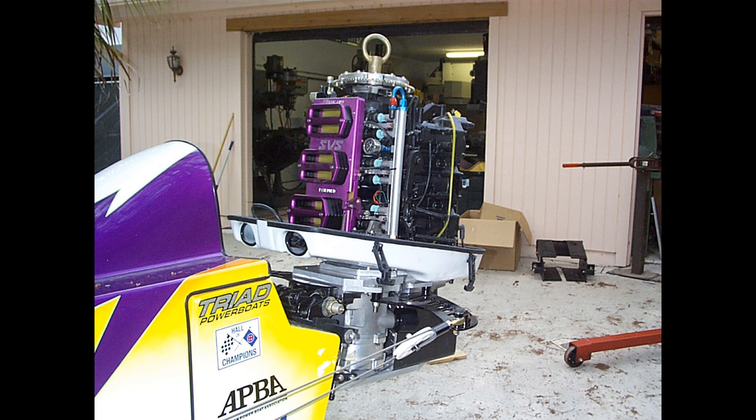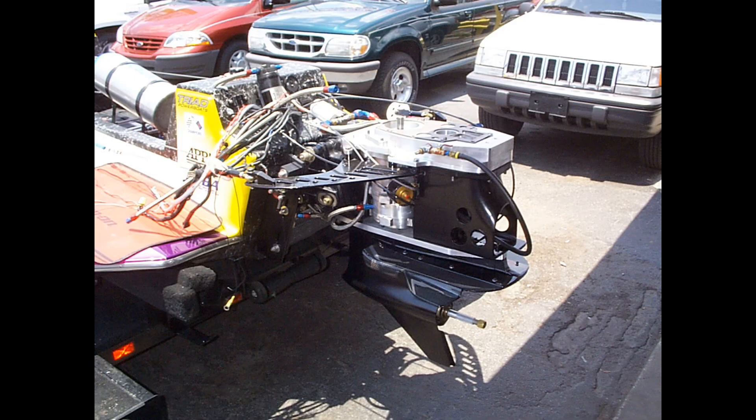This is something pretty interesting — a 3-liter race boat where a customer rebuilt a special SVS air intake in purple. But the really neat part: look below the power head in the midsection — that's a Lenko two-speed transmission. Outboards don't normally have a shifting transmission other than forward and reverse, but this let the low-revving 3-liter Mercury, which was only good to about 9,000 RPM, shift into high gear. It used an electric water pump and CO2 bottle for air shifting — a pretty neat project, but the customer lost interest and it never saw its full potential.